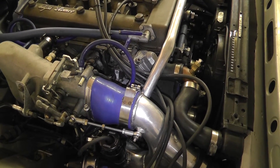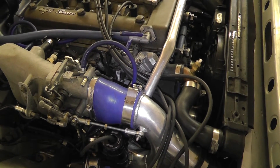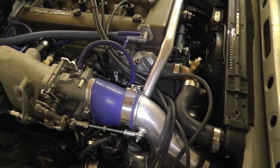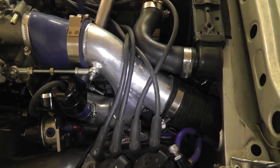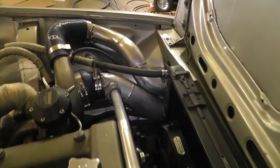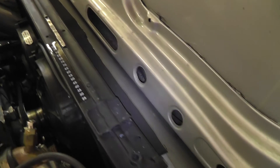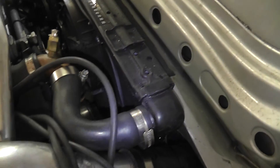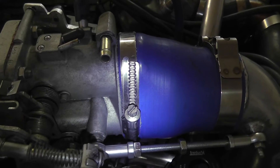So what do you do if you don't want the supercharger to run all the time? You bypass it and hopefully get the best of both worlds — that's what I've just completed. Looking at the airflow first: you've got the turbo up front, then an intercooler running across, through the intercooler, underneath the car into the supercharger, then out of the supercharger as you can see there, and currently straight into the inlet.